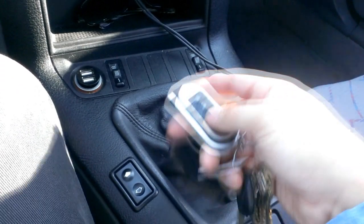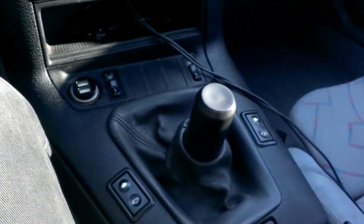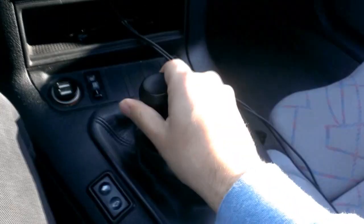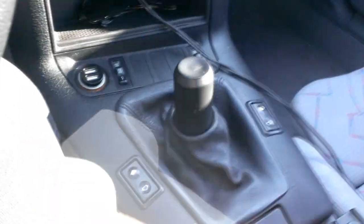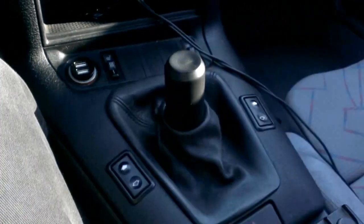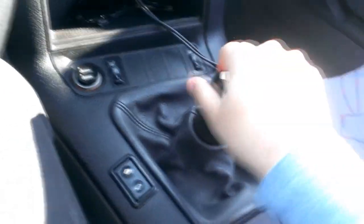So I've just done this — I have my alarm in automatic mode, so when I remote start, it is in neutral. The car turns on, but now if I go to first gear, it just turns off. Right now I won't be able to start my car because it's in first gear and it's hitting my neutral switch, which grounds the remote start out, preventing it from starting.